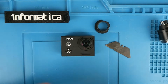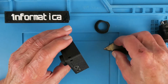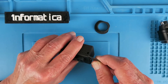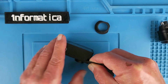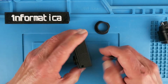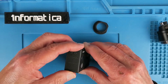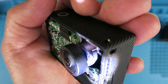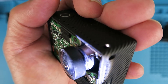So that when I reassemble it, I know that the lens is in the right place for focus. It looks like there's a seam along the top here. Just clicking it apart carefully and not being too aggressive, as often there are little ribbon cables or other delicate things very close to the edge inside. Sometimes a fingernail is the best option. There are these little plastic tabs which, with a little bit of force, will release.